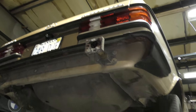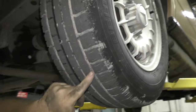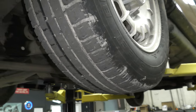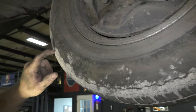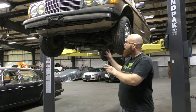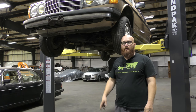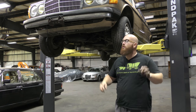Let's check the tires — bad, bad, bad cracked. Very, very bad. On this one the tread is actually starting to separate. Under highway speeds, the centrifugal force will actually pull the steel belt away and then the tire will just blow out. That's very dangerous. With all those things we found loose underneath the car, if you were to try to take this on the road, the amount of clunking all over the car would drive you crazy.